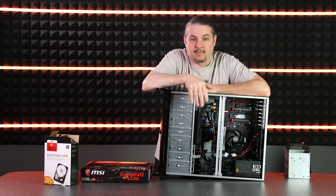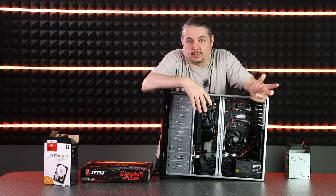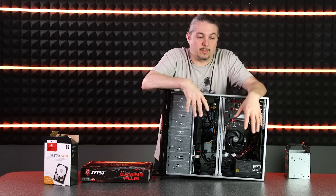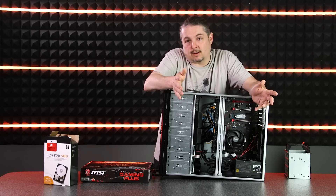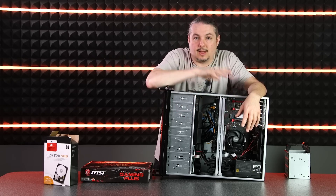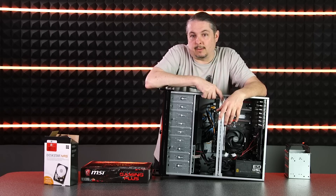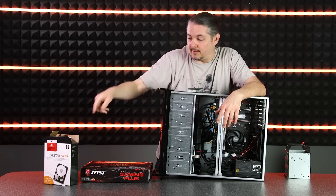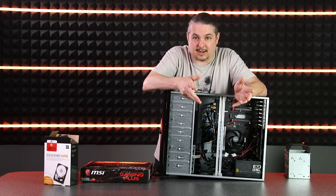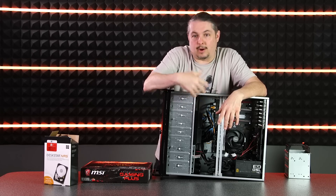We went with the MSI x370 board. With the UniFi NVR, because the cameras break things down into H.264, there's not a lot of processor power needed for getting the camera footage and rendering. Some other NVR software we've used heavily relies on the processor, but with UniFi builds much less so. Someone is undoubtedly going to comment 'why didn't you go enterprise?' — that really wasn't in their budget. We have six eight-terabyte NAS drives and we've built this similar system before. They're very reliable in the field and with standardized hardware, if anything goes wrong I can just swap it.